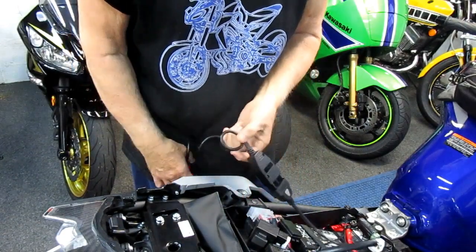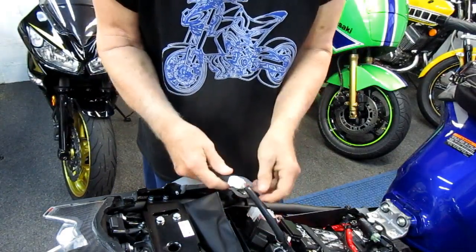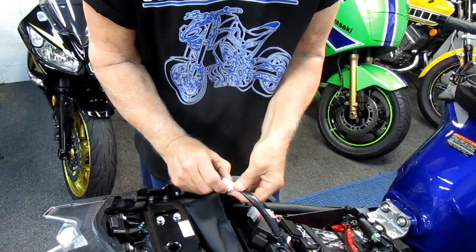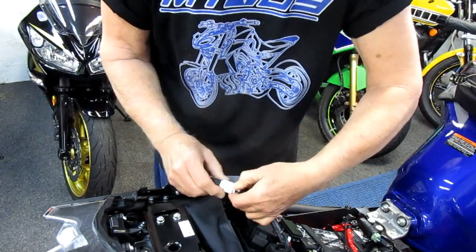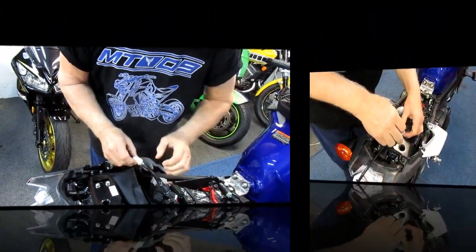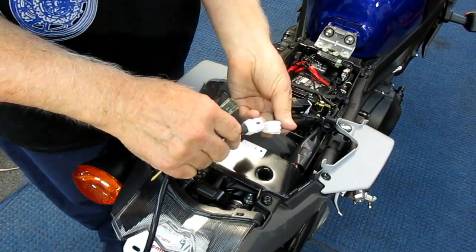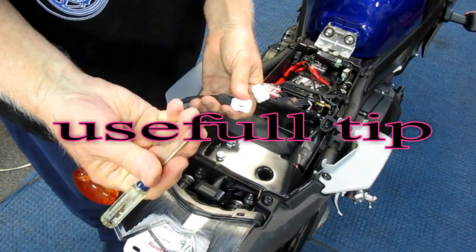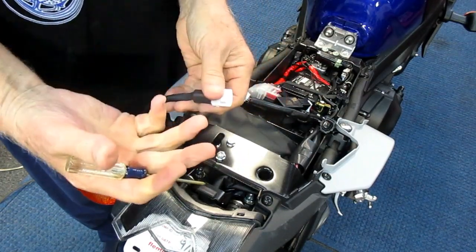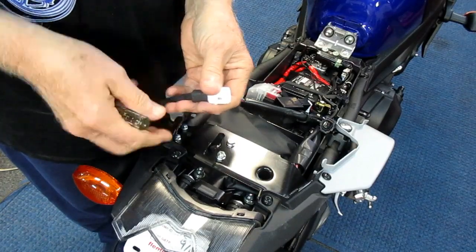With the code erased, this is another handy little thing to know. These little connectors — you don't ever want to just pull on them. They are delicate, just like the ones under the gas tank on a fuel-injected R1. If you pull on them without pressing the release, it's going to be a real problem. I need to pinch it — what I need is fingernails. I used a little Phillips screwdriver to press the little tang in to get it to release. What you don't want to do is just pull on it — it has a little safety tab. They all have connectors that you need to press down to pull apart.